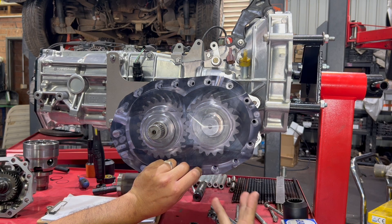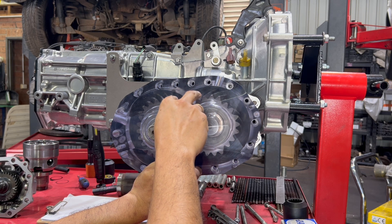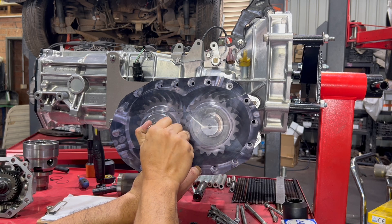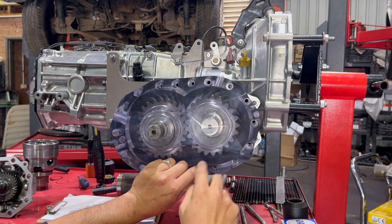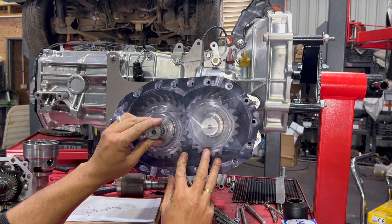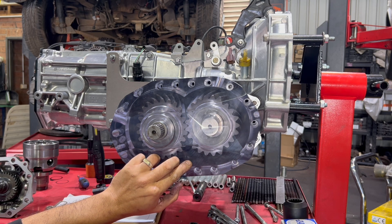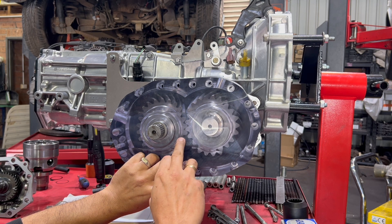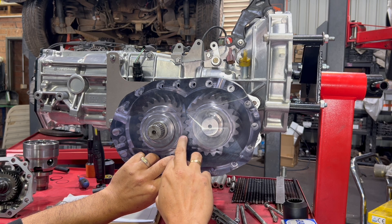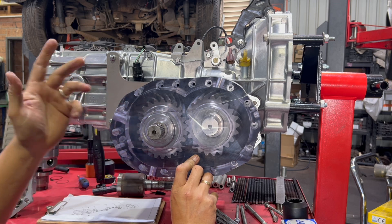The angles on the side of the design actually magnify the teeth — probably hard to see from the video but they do. Once we get driving we'll be able to check the teeth, and you can see the backlash on that flat part, which is set at 0.1 of a millimetre at the moment. We could probably bring it down to 0.08 or even 0.06 millimetre backlash gap, but we started at 0.1 which we think will be okay for now, and we'll test and see.